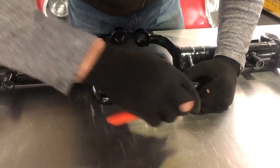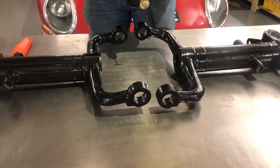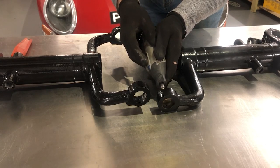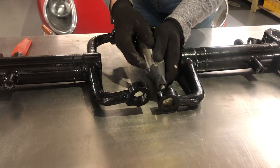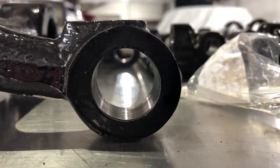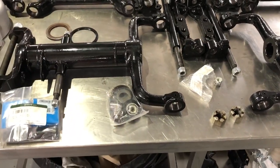I'm carefully scraping out inside all of these areas to get rid of any drips and excess paint. I don't want to go in too hard because that will actually score the surface. In addition to that, I've got this Dremel wire brush — I find these really helpful in clearing out things like this in a not aggressive way. They get rid of the paint and polish up the surface, which is very handy. Now that I've got all the bearing surfaces clean, I can clean down the workbench again.